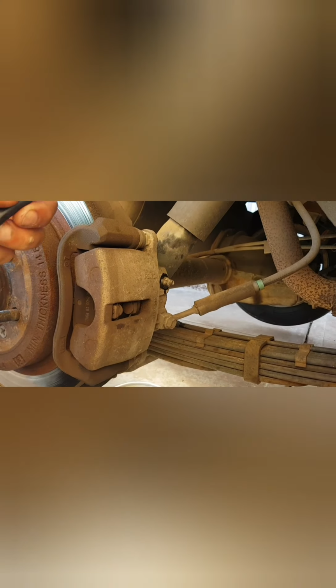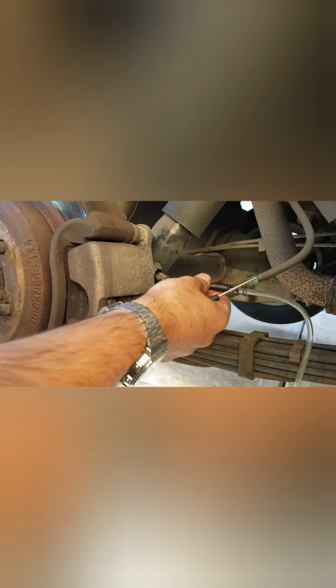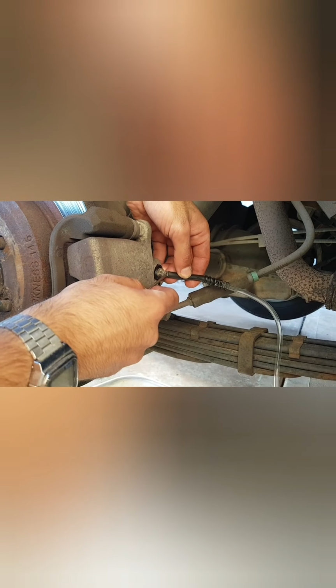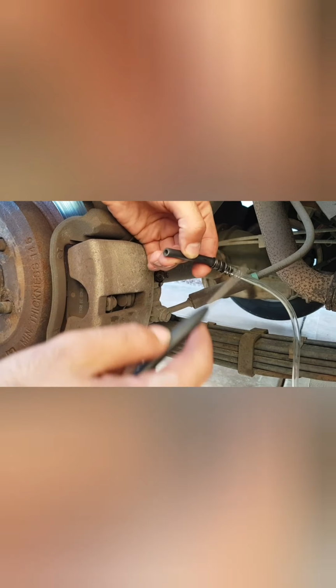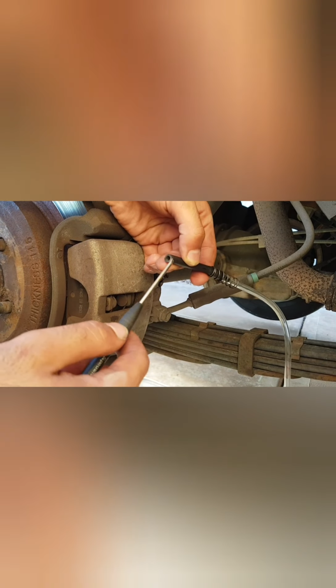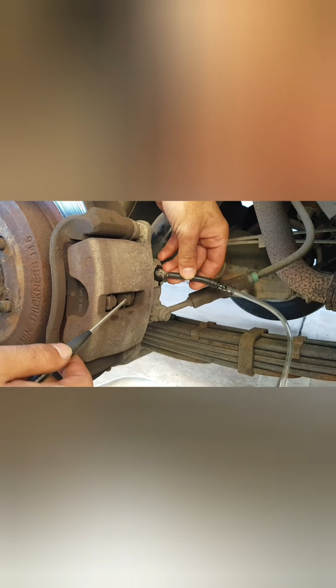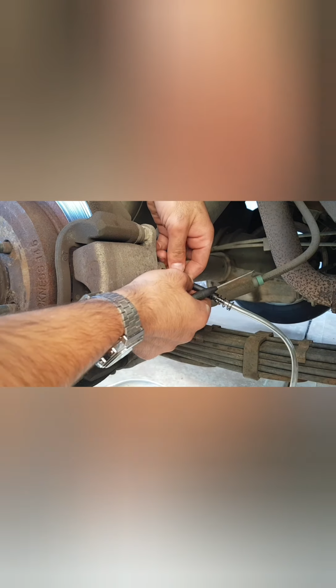Okay, and this is now where it gets a little fiddly with this particular product that I've got now. I'm sure there's many other products. You may even use just some wider gauge piping that may work a little easier, but I found in this specific Ford Falcon BA with this specific Tool Pro product, using this flat head to open the mouth, I was able to get this over. So with a little persuasion, this grommet goes over.